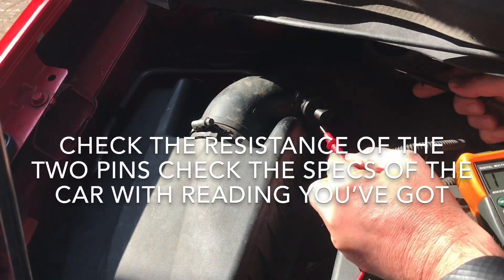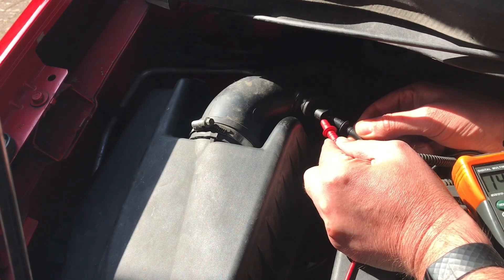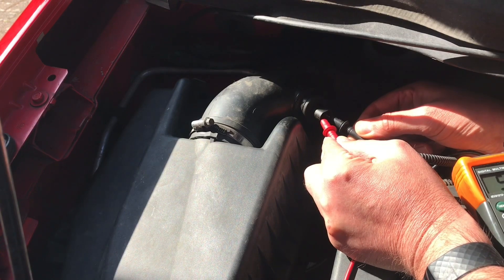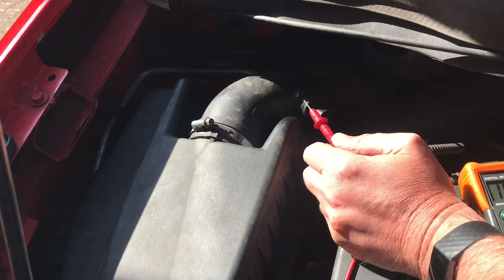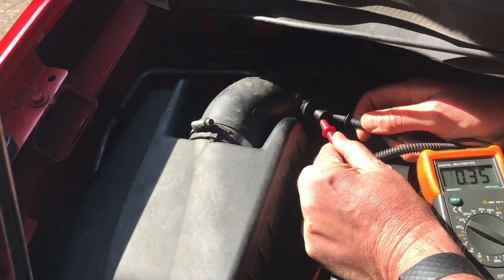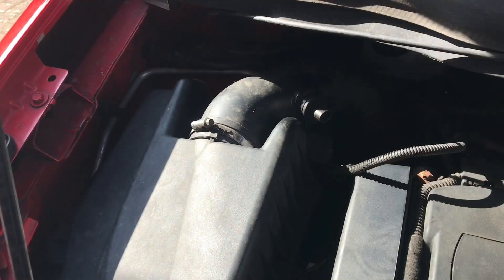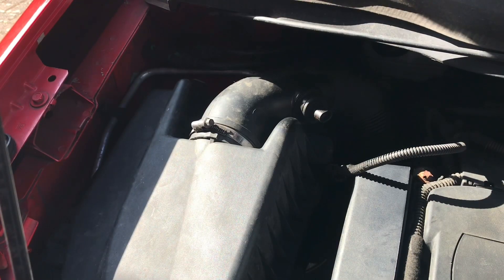So the first thing I'm going to do is an ohms test on the actual sensor. I've got about five ohms, and obviously I need to check that with the specs of the car to see what the sensor is actually specified at — a good sensor is specified, so you need to compare that to something. There are only two pins on this. The resistance is five ohms, and you can do a test where you could send warm air through the duct and perhaps watch the sensor react to it.